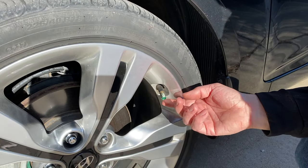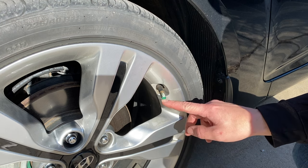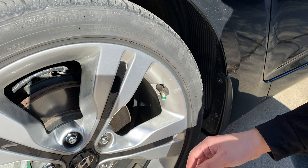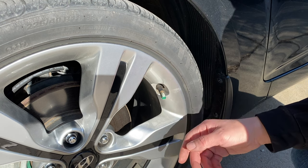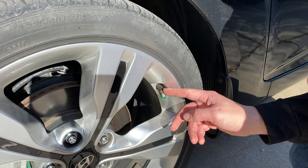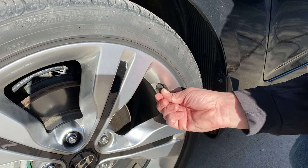So these are the aluminum valve stem caps that a lot of people put on their cars. This one actually looks like it was put on at the place, because inside it says N2 — nitrogen — which was or maybe still is a thing. These corrode up here in the northern states. I live in Michigan, so it's corroded. I think this is brass, or I'm not sure exactly what this is made out of, but the valve stem I think is made out of brass. So they corrode together and they are impossible to get off.